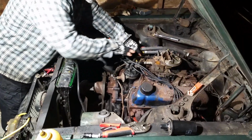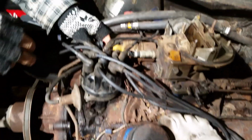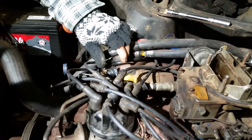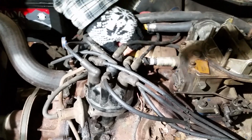Let's shut the lights off first. Hold on, let me see if it'll fire up. Ready? Oh my god. So we're checking the coil, putting it back on the old coil to see if that'll fire it up. If not, then we'll put the other coil. You can warm your hands here now. Jeez. You guys in the warm countries don't understand what we gotta deal with. It's alright, it's all smiles. She's running. Old coil, test one, ready? Old coil is good. Okay, so it's definitely the ground then.